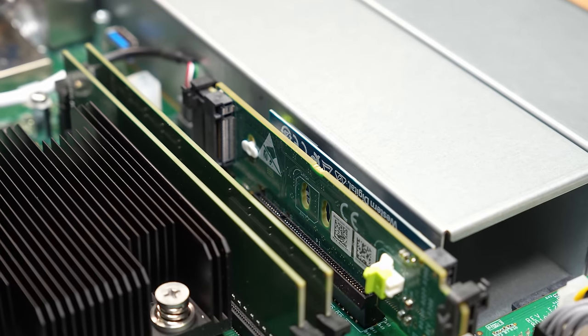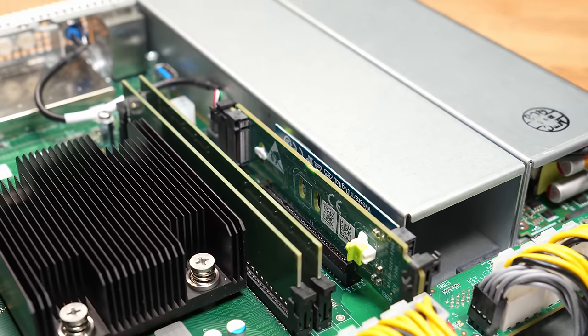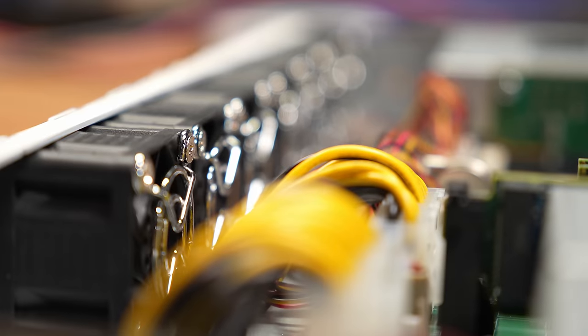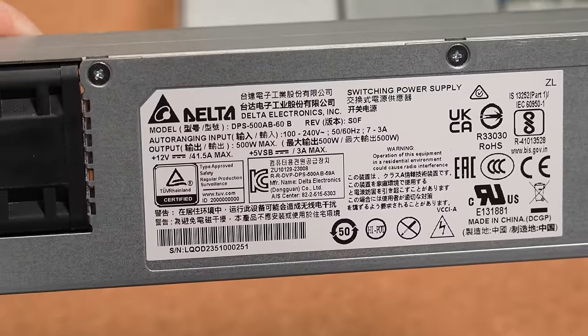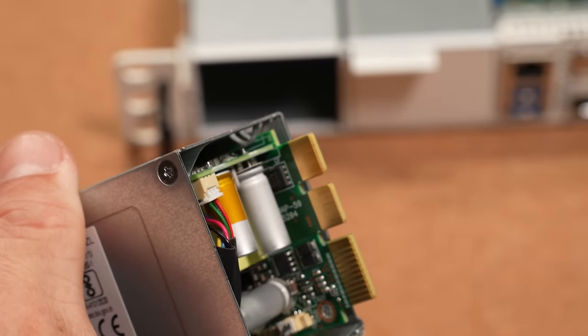Storage is provided by a 512GB NVMe. We have 16GB of DDR4 ECC memory expandable to 32GB. Cooling is handled by active internal fans — there are plenty of them. We have dual hotswap power supply bays; the unit as shipped has one 500W hot-swappable PSU with the option for a second.